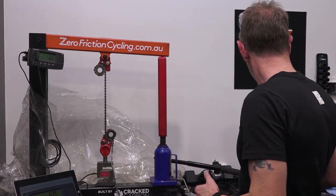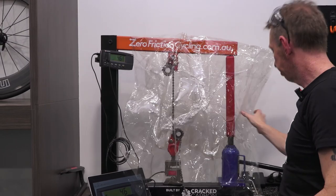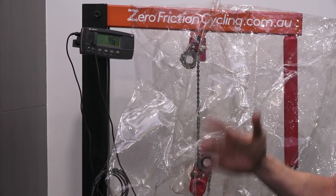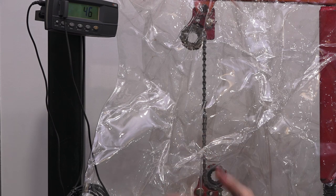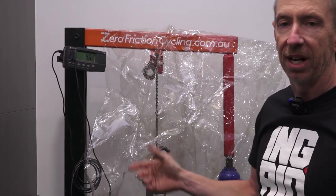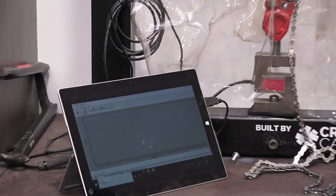And so we'll find out live, I haven't tested this before, as to whether or not it also has a greater tensile strength. But bearing in mind, it is a straight line. Even if it comes out similar to Ultegra, or just a little bit more, or fairly much in line with a lot of chains that are in that sort of 9 to 10,000 Newton range, that doesn't necessarily mean that it doesn't have the greater pin riveting strength that the e-bike chains need to handle the extra oomph that people are giving it quite often under high chain line angles and also under some pretty clunky shifts. So we will test and see. All is about to be revealed.